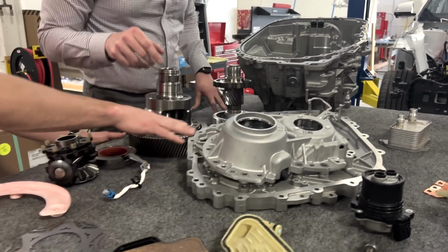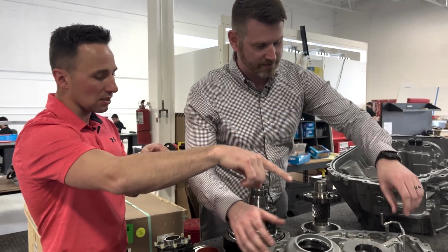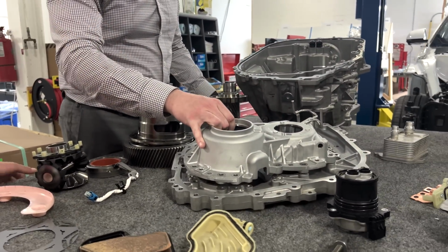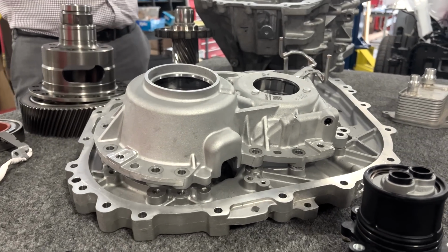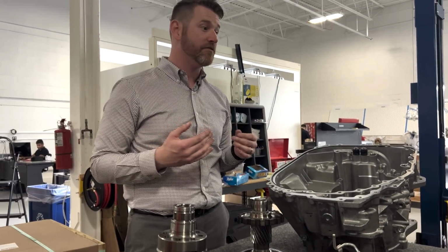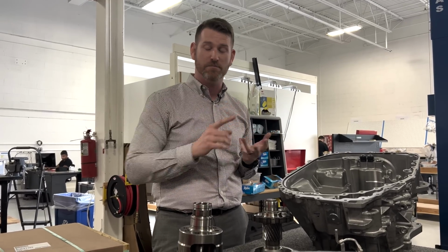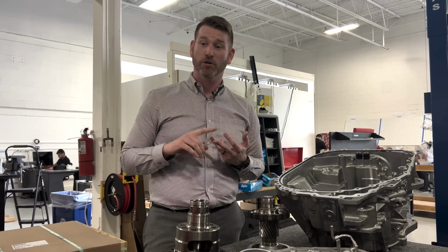And by bulkhead, Kevin, you're saying this is actually sandwiched in between these two cast pieces, and this is largely carrying the gear drive unit component structurally, right? Yes. Okay. And in general, the bottom line up front with this is it's a very conventional execution, I think favoring speed, manufacturability, maybe at the price of some efficiency as far as components. And performance as far as being robust.